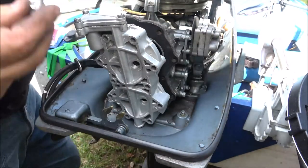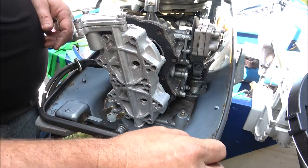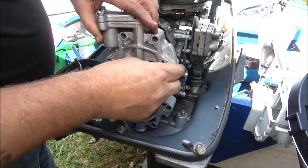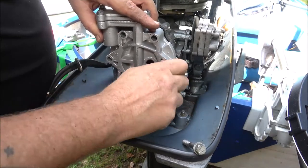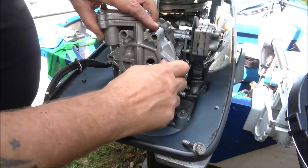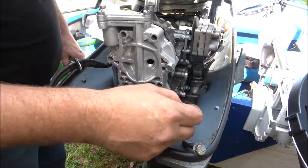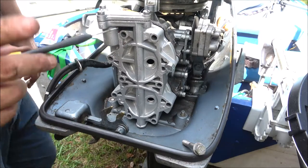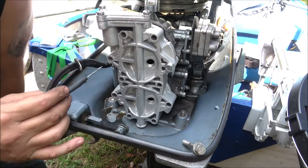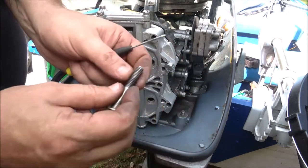These are just shoulder bolts. I ran these bolts all the way in and back out - you can use a tap if you have one, but they went in pretty decent so I didn't feel I needed it. What I also did was run a little tiny screwdriver up into these holes. Some are blocked off, and the ones that aren't blocked off - except for two of them - go way in. I've got those marked: there's one there, one here, and one down at the bottom.